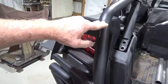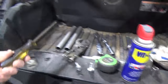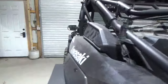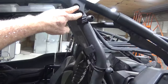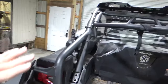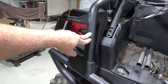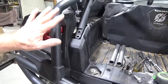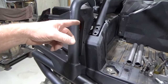I'm going to end up taking this off to make it easier because it was nearly impossible to line that up — sticking something down in a hole and prying it over, this thing would not move. I ended up removing the bolts up here because after loosening them I had a ratchet strap on there and everything and I couldn't get it to move. Now the only thing holding that top bar is the roof mount, so you can move it a little bit. Once I get this out, the whole thing is going to move really easy, and that's what you want. Take the time to make it easier for yourself and not screw up — because if you cross-thread those, it's going to ruin your day.